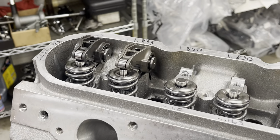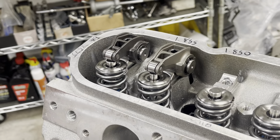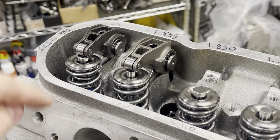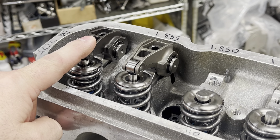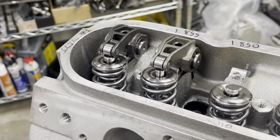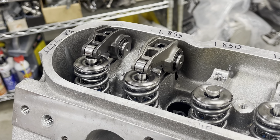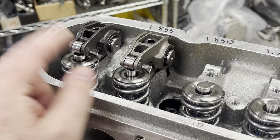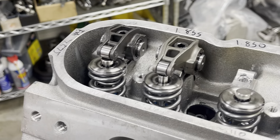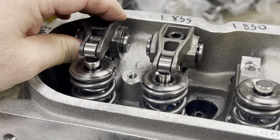There are two ways to do this, but the easiest way is to check the intake first. We're going to wait for the exhaust to just crack open, and Alec's going to turn it over for us. There's the exhaust just starting to open, so we know this cylinder is on the base circle. I'll show you in just a second exactly why that's the case.